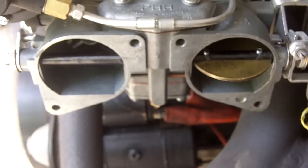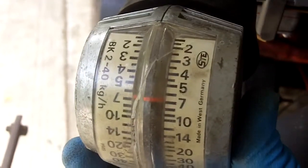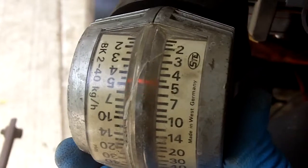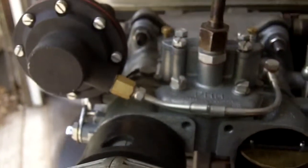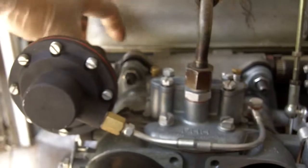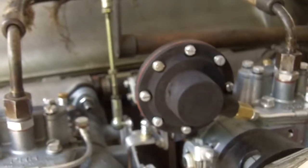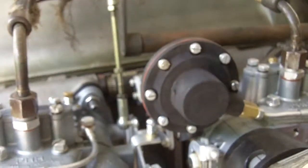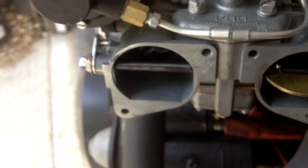Let's see if anything's changed. I was up a little bit — that's the front of the self-adjusting carburetors, so let's see what changed. We're up to seven here, so if we push on the... Yeah. What I did was I pushed on the counterweight back here. Let's see what this guy's doing over here — looks like that one stayed about the same, but we'll push on the counterweight just in case. That one changed a little bit. The second barrel of each carburetor is our problem area.